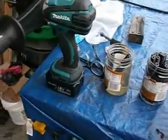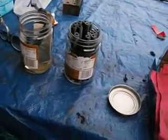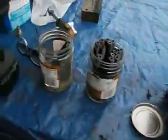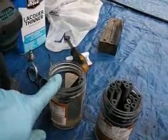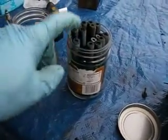Okay, Leroy Diesel, one more time — this is some head studs that I'm installing. These are the ARP head studs right here, ARP — the instructions and all that good stuff. What I've done here is I've put some lacquer thinner in this cup, and you can see that over there. That's to clean the oil off of these bolts as they come from the factory.